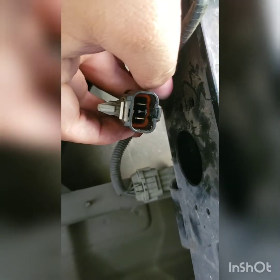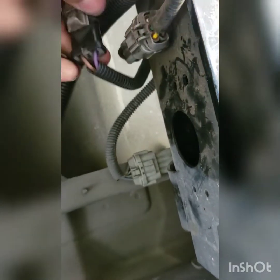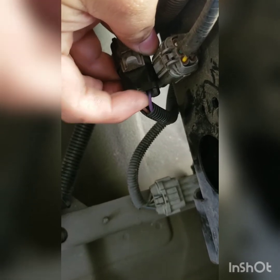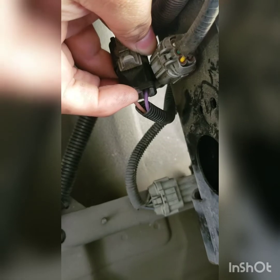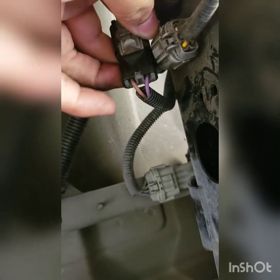So you don't lose your orientation, just hold the wire and flip the connector — that's why the piece that goes into the rail is facing that way. Turn it, push the wires back in. I only heard a click on one of them but they're both secure, so you may hear a click on both. The wires on the back end have a rubber boot seal — make sure those are pushed flat. This retaining clip has a ridge on the other side, so make sure the rubber seal is flush with the plastic, then push the retaining clip in.